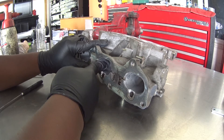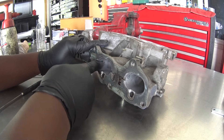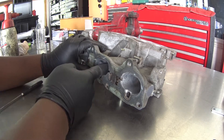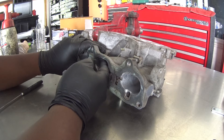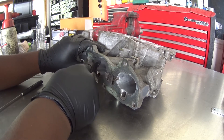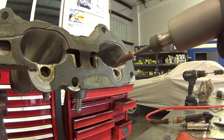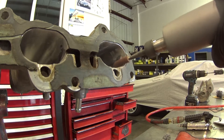I only kept the left and right outer parts of the manifold where the shaft came through the ends, using some plastic and a two-part epoxy. As long as you have a new intake manifold gasket and it is torqued correctly and mounted properly, you should have zero issues with holes being left open. If you'd like to close these, have them welded shut and then reshape your ports and sand. To shape the quicksteel, I started with a 120 grit sanding roll and slowly worked the excess material down to the same basic shape of the runner. I repeated the step across all four runners.